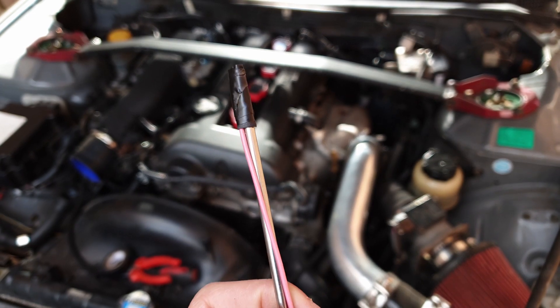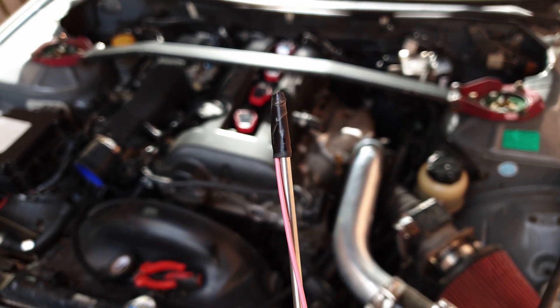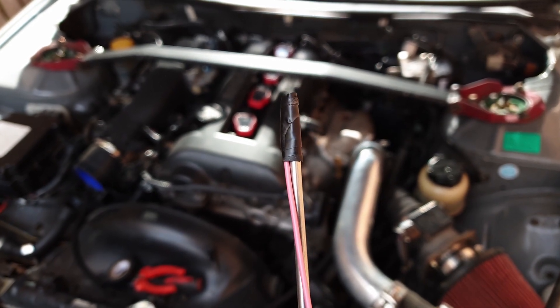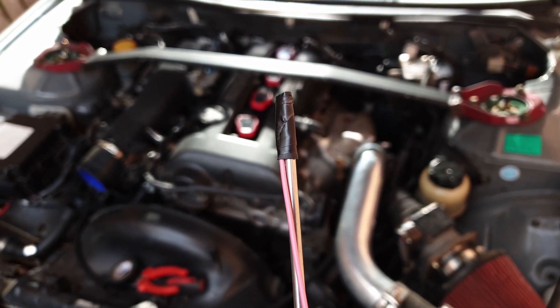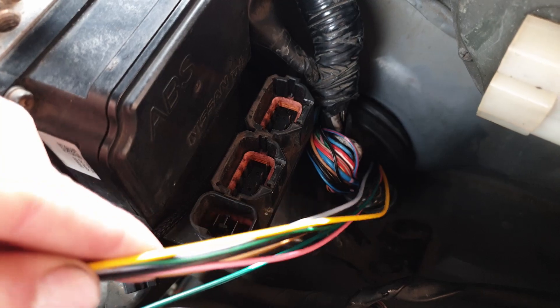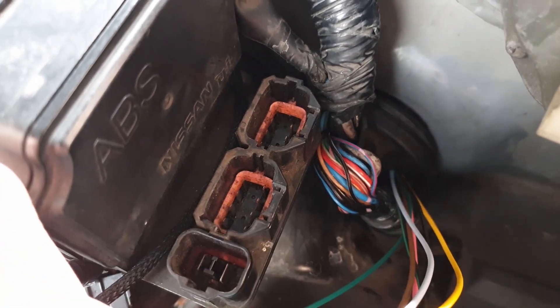What I've got is a really thin metal rod and I'm just going to sellotape the electric wire to the rod. There's a tiny hole in the grommet that I've made and I'm just going to push that through into the passenger footwell. Down here I've got all of the wiring I'm going to need for the wideband and the intake air temperature sensor, which just goes through that little hole I've made there.